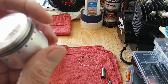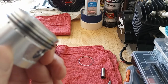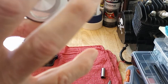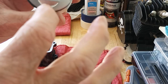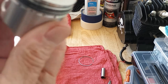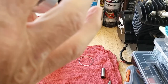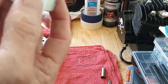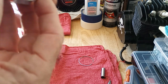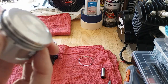Another thing you want to do before you install these pistons is clock the rings — like 10, 2, and 6. What you do is put the openings at those positions: put this one maybe at 10, put the compression ring at 2, and then put the oil control ring down at 6. You want to separate those gaps. Okay, let's pop that other ring on.